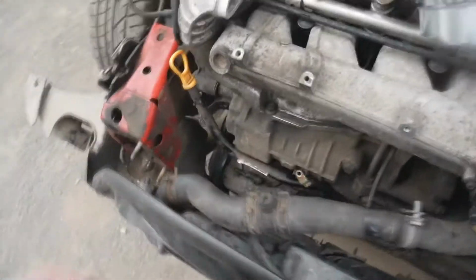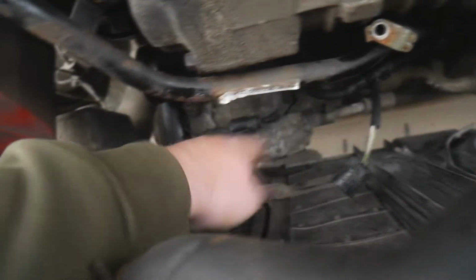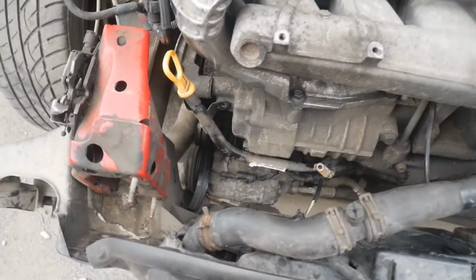Okay, so first things first, what I'm going to do is actually get the alternator down into this space here. I basically pushed the bumper back and the radiator back a touch last night, and then next on the list we'll obviously get it back onto the belt. So after we've got it in and under the belt, I'll plug the wiring harness in and then connect the earth, and then we'll bolt it back up into place.